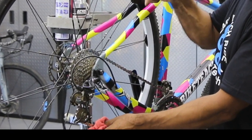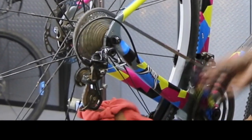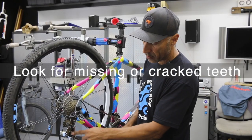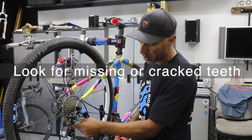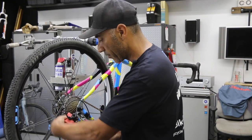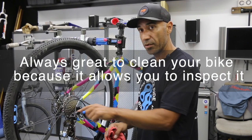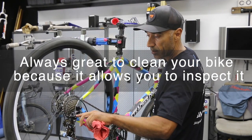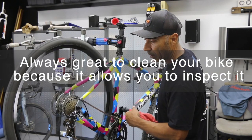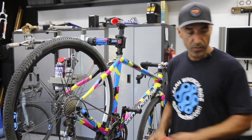I like to clean the tops, bottoms, and sides of the chain. While you're here, inspect your pulley wheels — if they look gooky, go ahead and clean those off. Watch your fingers. Wipe down your derailleur; you can always hit the pivot points on your derailleur after a wash. Go ahead and lubricate the derailleur — I've got a front derailleur too.